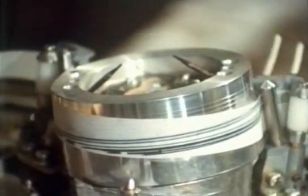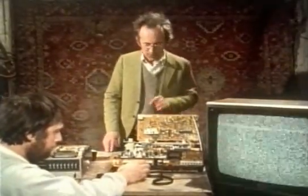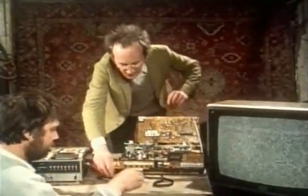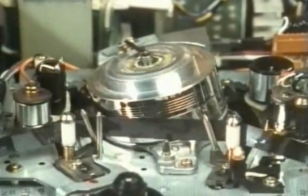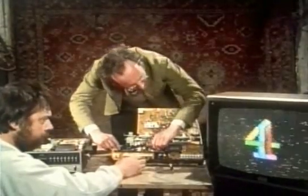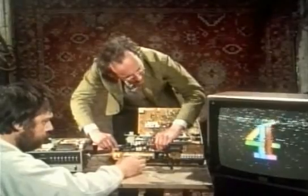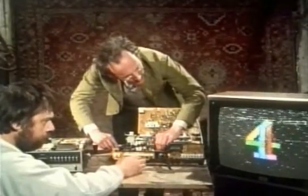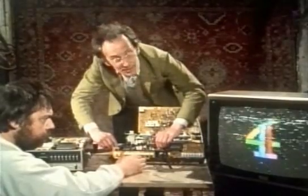In the real machine the stripes are much closer together. And if Rex and I lace up a bit of tape — it's a bit tricky to get it right — you can see that when the tape's stationary, the spinning heads are reading one stripe over and over again, and this produces the still picture.